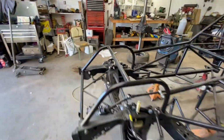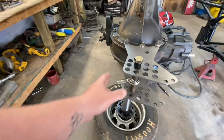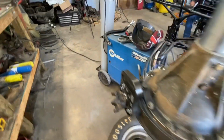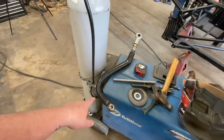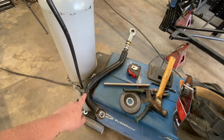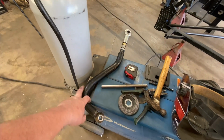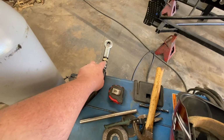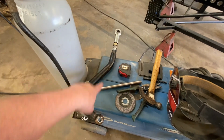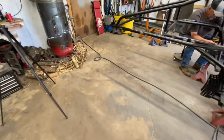But Pops got us fixed up this morning. He found the spacers for our pull bar bracket and got a heim just stuck in there just to make sure. And if y'all remember, we changed the J-bar on Blake's car, and this J-bar is bent. But we're just going to use it for now to get our center to center, and then we can order a new tube because this adjuster and everything is all new. So we'll figure out our center to center, then we'll order a J-bar that's not bent.